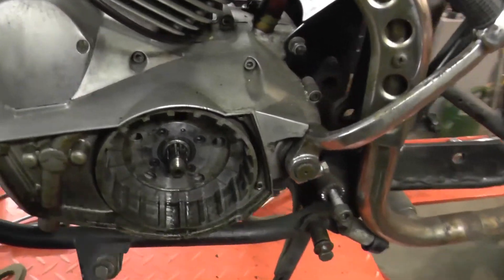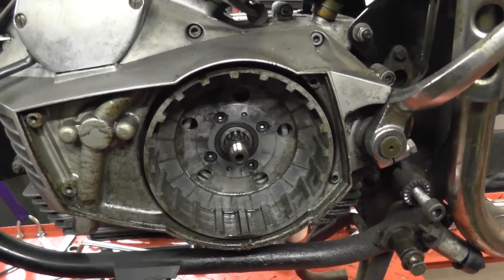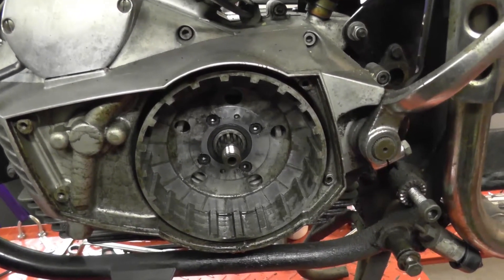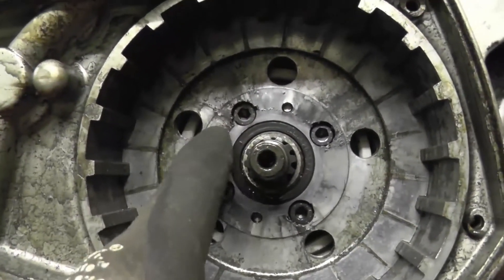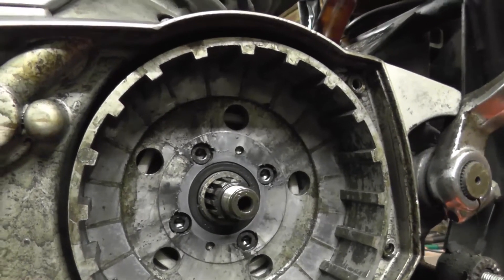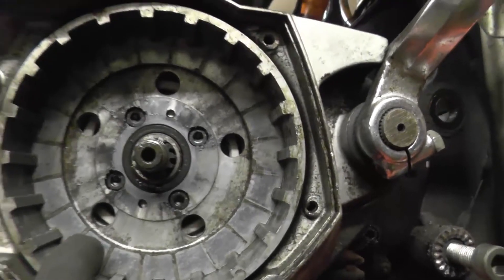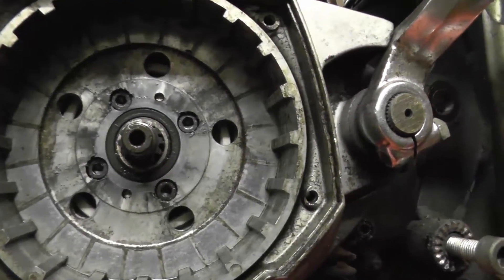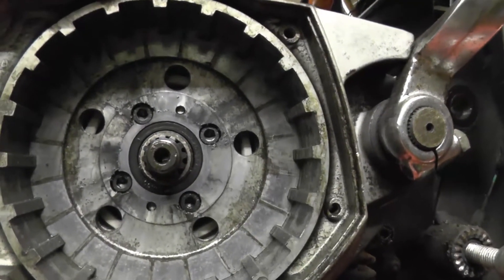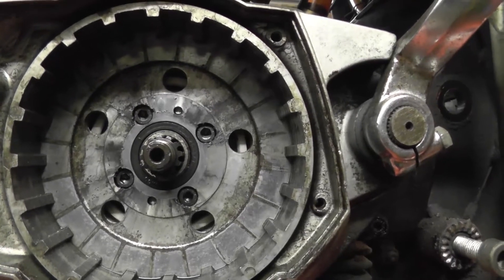Round on the other side we've had the clutch apart, and as you can see that's not what you call a dry clutch — it is distinctly damp. Now I don't think it's coming from the big seal. You can see through the hole in the basket the edge of the seal — that black ring — and that all appears to be dry back there, and I don't think it's this seal either. I think it's the clutch bush not sealing to the gearbox input shaft. That should have a smear of Hylomar to seal that sleeve to the shaft.